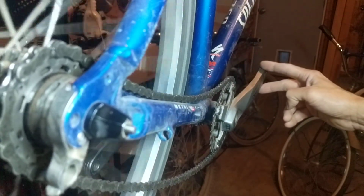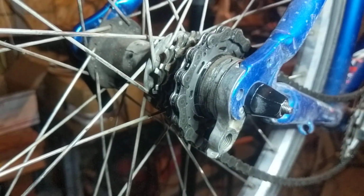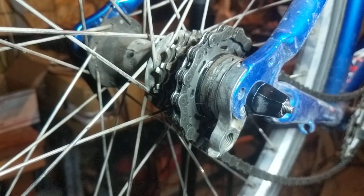Now some of you might be saying, wait, the gear didn't turn once, the crank turned once. But remember, the crank is bolted to the gear. So if one turns, the other one has to turn. Okay? So this one back here turned 2 times. This one turned 1 time. And that's what I want you to focus on this entire homework. That's how I describe gear ratios.